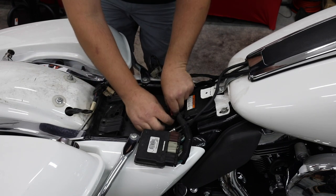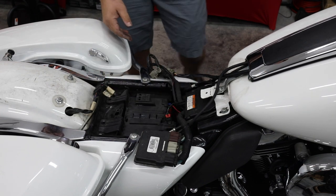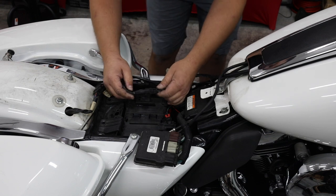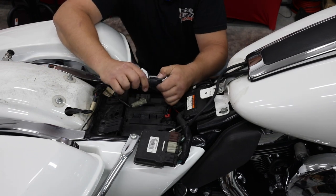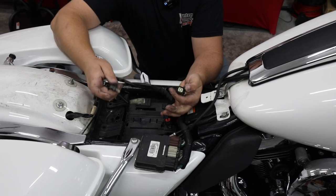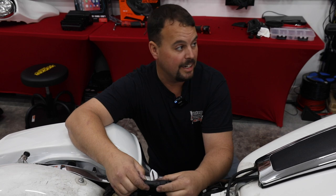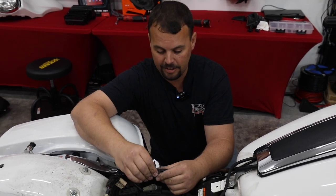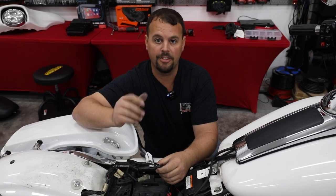But I wanna talk to you about something else. So this is a police bike. We've run into this many, many times: there's actually a plug underneath the back seat. This is that plug that hooks the horn connections that are actually in it now to a siren. And it allows them to hit what would be the horn button, and it actually would honk the siren.